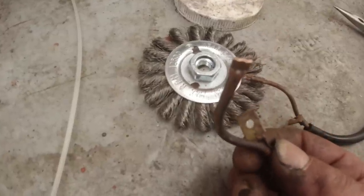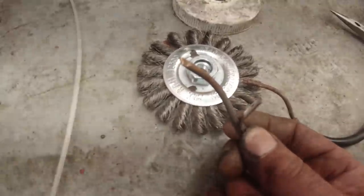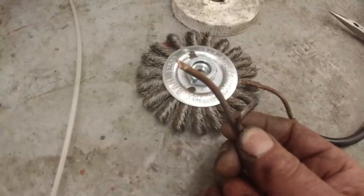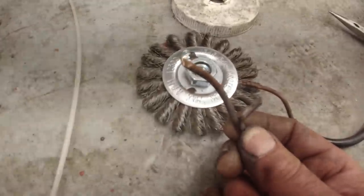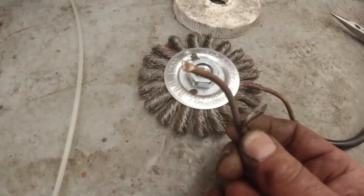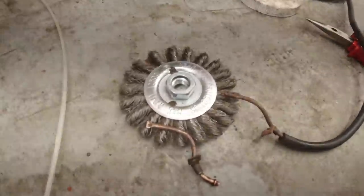So it's just a crimped copper twin nozzled affair. So you get two jets. One hits the middle of the screen, or just under, maybe a third in. The other one two thirds up the screen. And I like them exactly lined up. Another OCD thing for you.